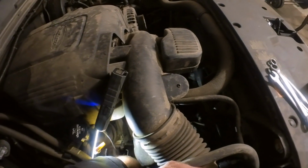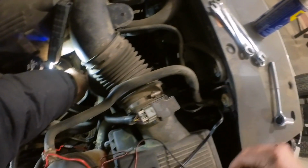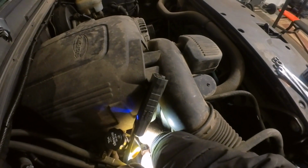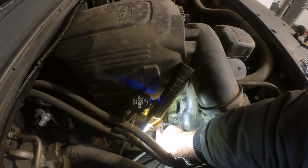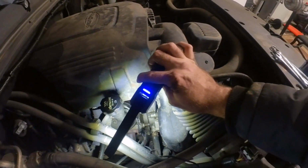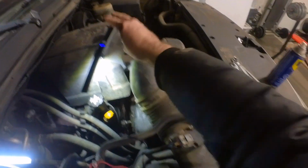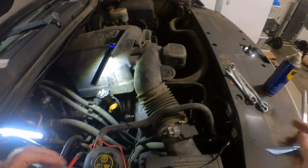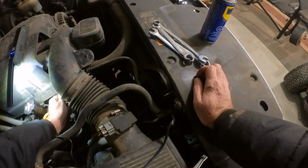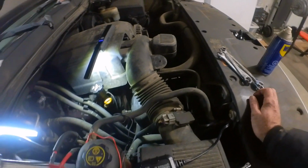Okay. This ground strap back up here. And we'll bring the nut back over. That started. So it'll take this. Oh, does that say 243? They are 243s. I think they're the good heads, aren't they? We'll have to steal them off this, put it on the Camaro. Okay, so we'll tighten that back up, and we'll have our ground all hooked up. Okay, you don't want to go too tight because it's aluminum. Anyway, so we got our ground on.